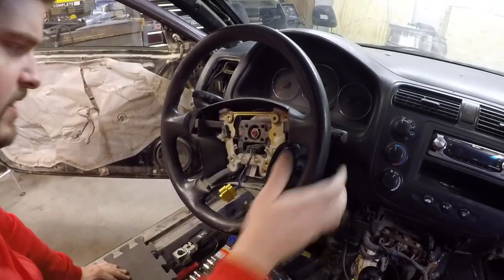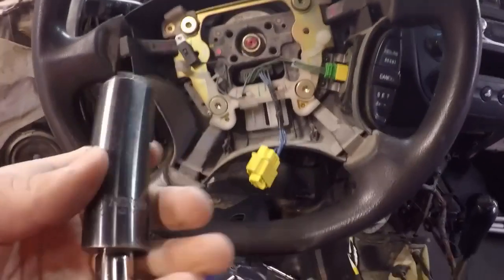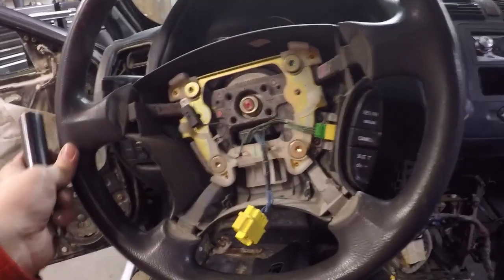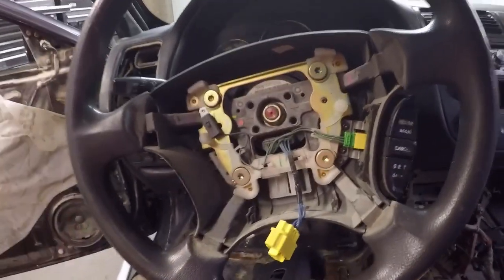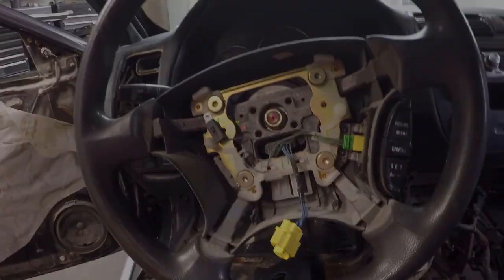The airbag clip — just like that, not too bad, they do kind of suck to get loose. Now that's off we can go ahead and take the steering wheel off. This bolt here is a 19-millimeter — went ahead and broke it loose with a breaker bar. Luke was able to hold it down; if you can lock the steering wheel in place so it doesn't move, that helps. Next up we need to remove the horn and cruise control over here, disconnect those plugs, then basically pound on the steering wheel back and forth until it comes loose.